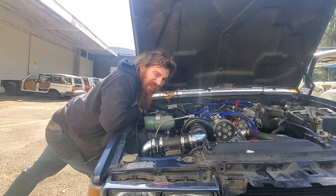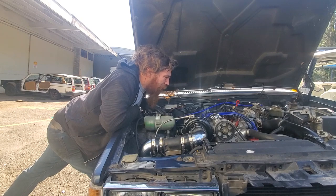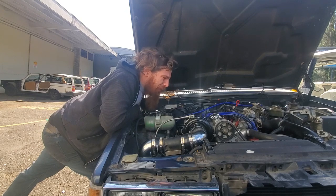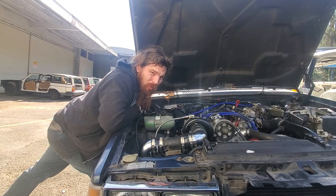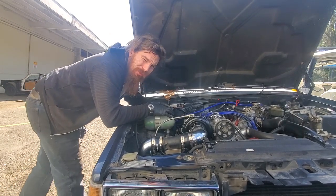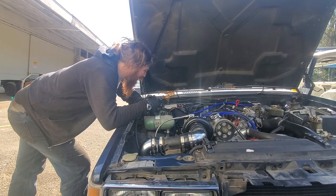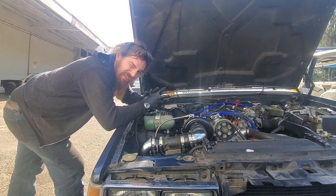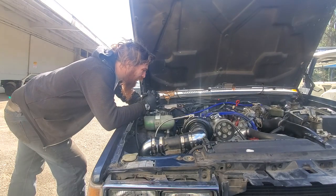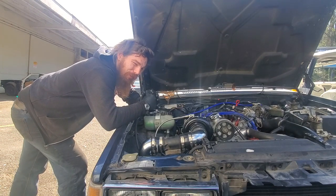In 1983 they were all 10-to-1 compression. In 1984, only the automatics were, not the manuals. So when I get those cars in and they're in rough shape, the motor runs and they're pretty solid, I pull them all. In this particular case, I'm going to show you what our finished product is going to be. This particular car belongs to one of my customers — we're wrapping it up for delivery this weekend. This is a 1988 740 wagon that we have done a B23 motor build on.